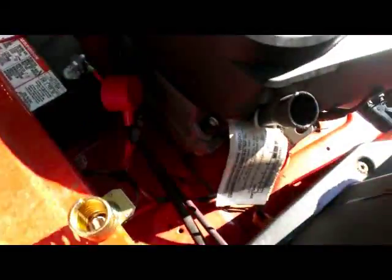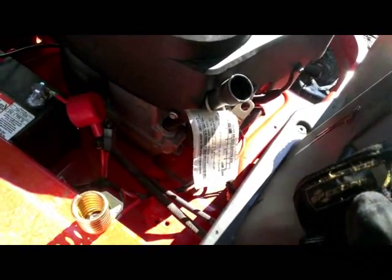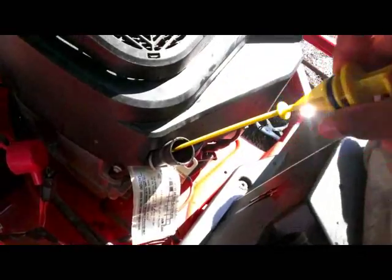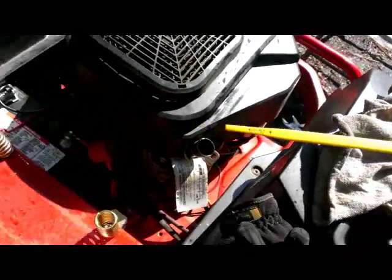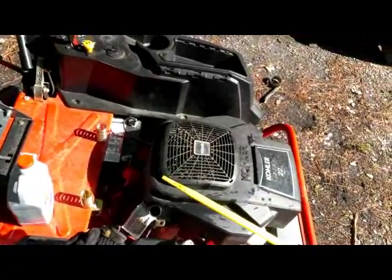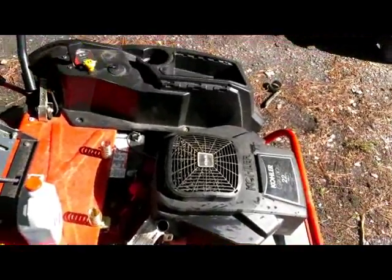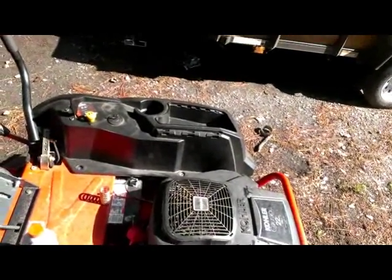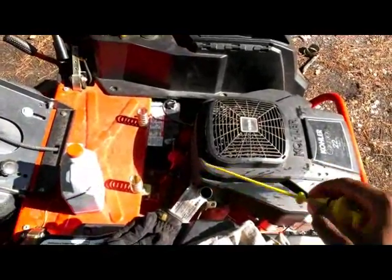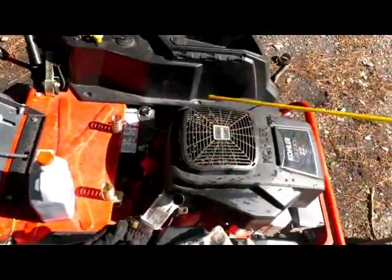The good thing about this engine is the oil spout is tilted. So when you're trying to get a good reading, put the stick towards the top and run it down — when you pull it out, the bottom side usually gives you a real good reading. I like to be very conscious of my oil amounts, because too little or too much oil can cause your motor to blow out. I don't fill it all the way up to the F — I fill it just below the F, because the oil that's around the spout is going to settle into the oil container. That's why I fill it just a little bit below the F.